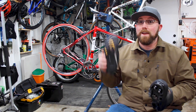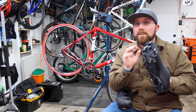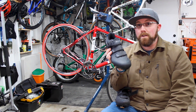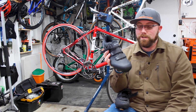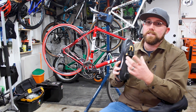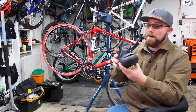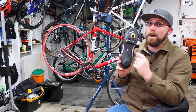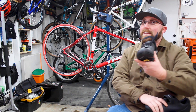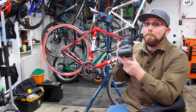Talking about cleats, one of the biggest differences I've noticed between a road and a mountain one is the contact patch of the cleat. With a mountain bike cleat, whether you have Shimano or Crank Brothers, you'll notice there is quite a bit more float. There is much less contact between your cleat and the pedal than there is on the road version of clipless pedals. While you're riding, you can move your heel around a little bit more while you're ripping on the trails. However, when you go to a road clipless pedal, that cleat is quite a bit larger — almost about the same size as the pedal itself — and this cleat and that pedal lock together pretty solid. There is not much float. Even with a cleat like this one that's supposed to allow plus or minus three degrees of float, they still don't move near as much as a mountain bike. I believe Shimano and Crank Brothers are like six degrees of float; this is only three. So you don't get very much play in your heel — it locks you in really solid with not much movement at all.